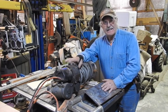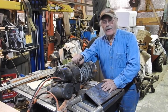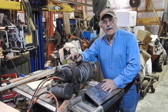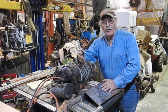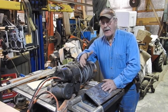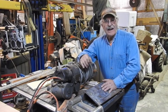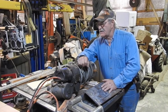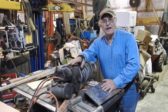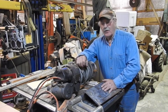I did that simply because I seemed to have trouble with this Ramsey all the time. I don't think it was necessarily operator error because the solenoids is what kept burning up. They recommend not leaving an extreme pull for an excess of 30 seconds at a time, and I never did that, and still don't on my Apex. But I still had repeated failures on those solenoids. So in the meantime, I went ahead and got another set of solenoids from the Ramsey Corporation and changed those out, so it's ready to go again.